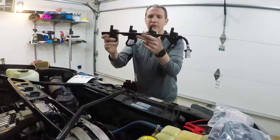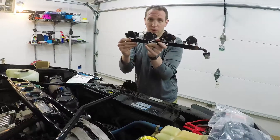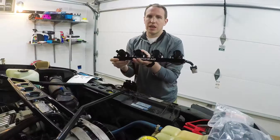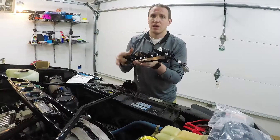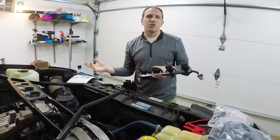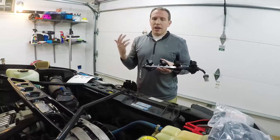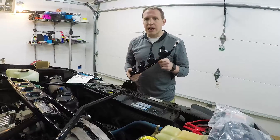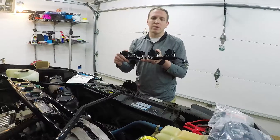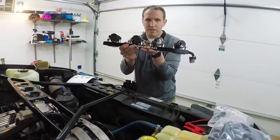It's all going to be replaced with this piece that looks kind of like an Opti-spark but isn't cam-driven. There's a sensor to pick up the crank hub signal. I'll also be selling my MSD Opti-spark and over-the-valve-cover spark plug wire setup once they're off the car. This setup uses eight coil packs mounted to the valve cover - four shown here - with shorter wires dropping down to each plug. These are all basically stock off-the-shelf GM parts, so any AutoZone or O'Reilly's can supply replacements.